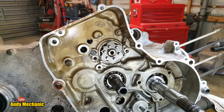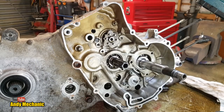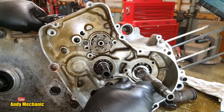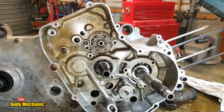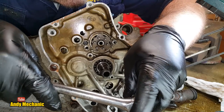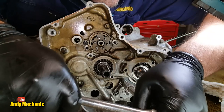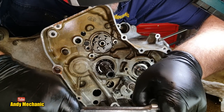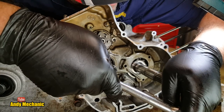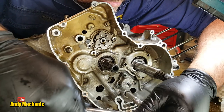Okay, last but not least, they want us to take the oil pump out, so let's pull you back a little bit. Not sure, these look the same bolts. Yeah, they are. Okay, maybe an extension bar, a bit more control. Okay, let's give it another go. The trick with this is you've got to push hard to keep it in the head of the bolt. Nope. Yes.